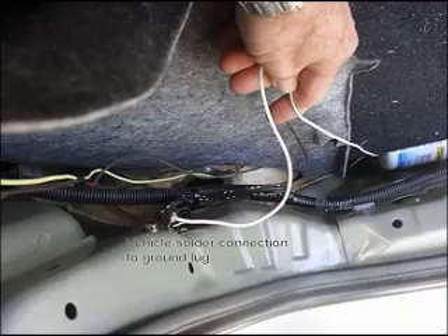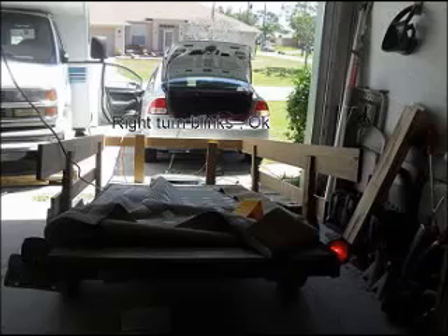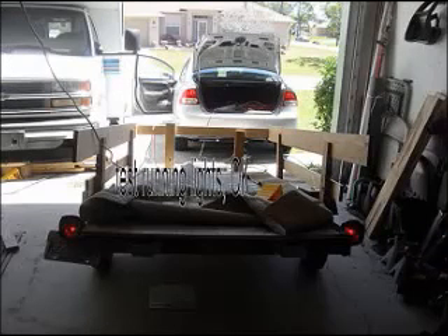Just to mention, this is for a light-duty trailer. If you have a heavy load you'll probably need to find on eBay a couple of single pole double throw relays that handle more current, and make sure you use wire suitable to handle that current. Just to show that it works — I've got the wires connected and I'm testing the left turn signal. The right side blinker and the running lights work as well.